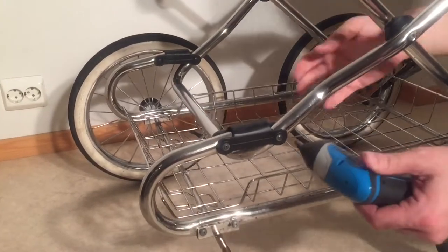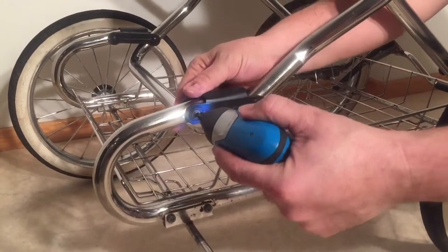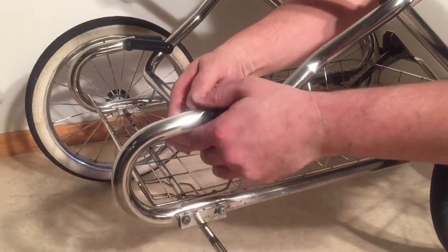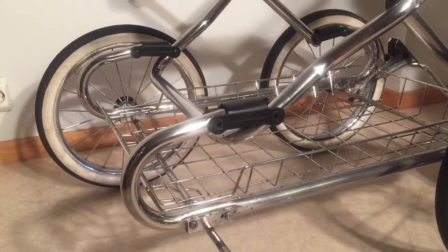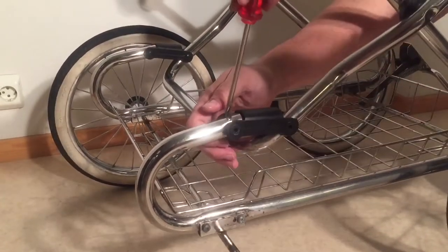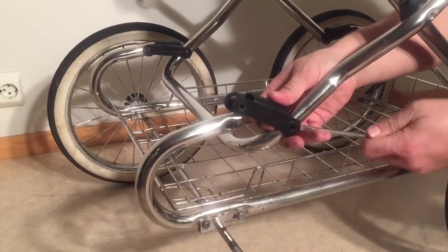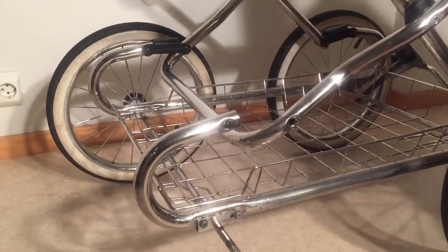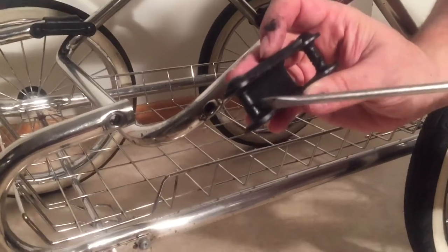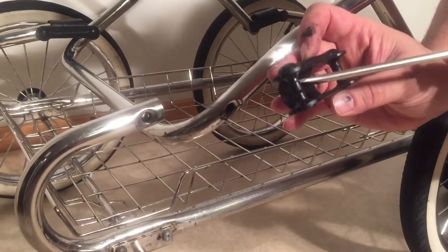Then you'll want to unscrew these. You can pull out the plastic peg on the inside — the screw goes through it and into a hole through the bar. Use a flathead screwdriver to pull these out. Then examine this plastic peg part for signs of damage. You can see that it's a bit worn in here — in this case it's only slightly worn, but sometimes it can be cut almost all the way through.